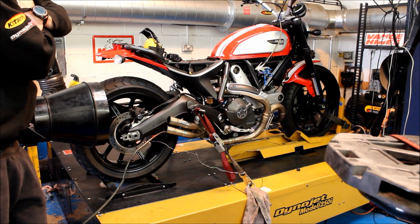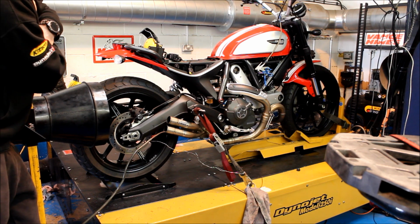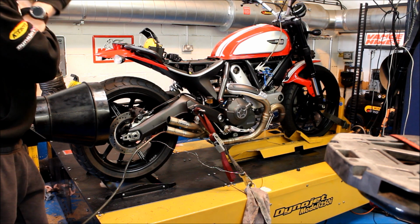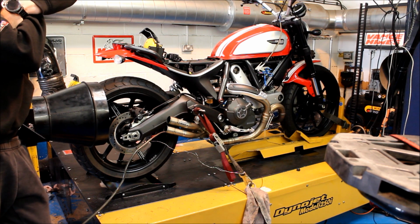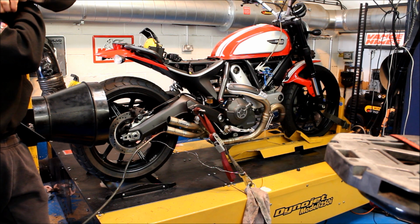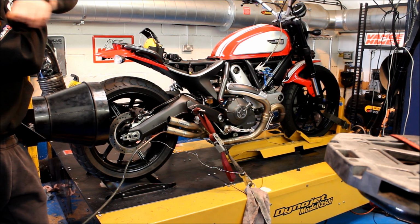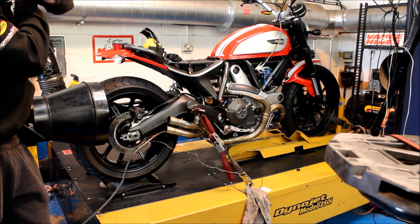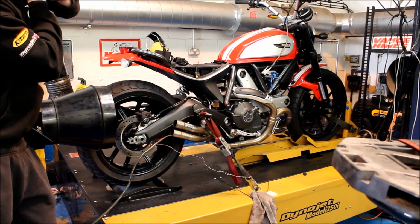We're done in terms of mapping. I've got a little bit of low end stuff to do, airbox pressure related fuel mapping. We've gone from 70 to 75 horse at the wheel. It doesn't sound like a lot, but it's nearly 10%. And it's the throttle response on these that really improves, ignoring the fact he's changed the exhaust and it was running lean. Even on a standard bike, we can do quite a lot to improve the throttle response. Really sharpen them up.